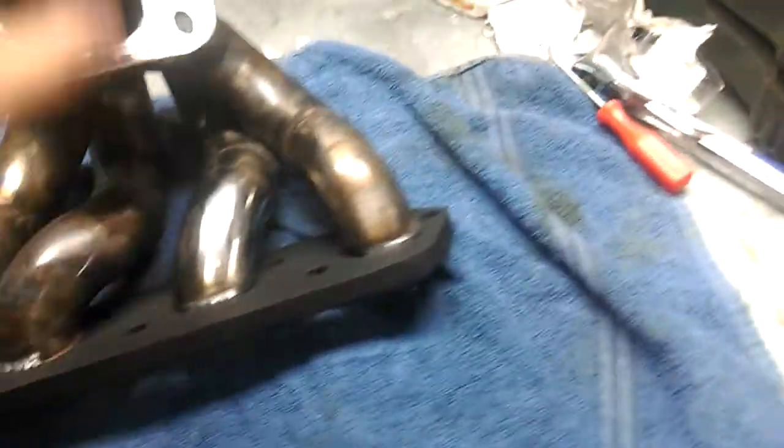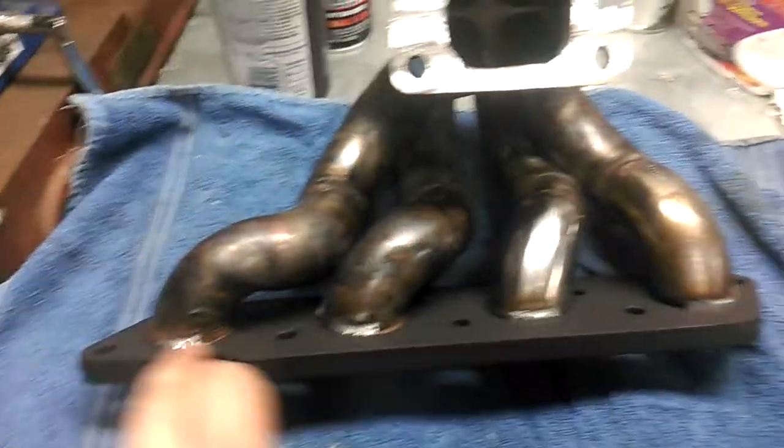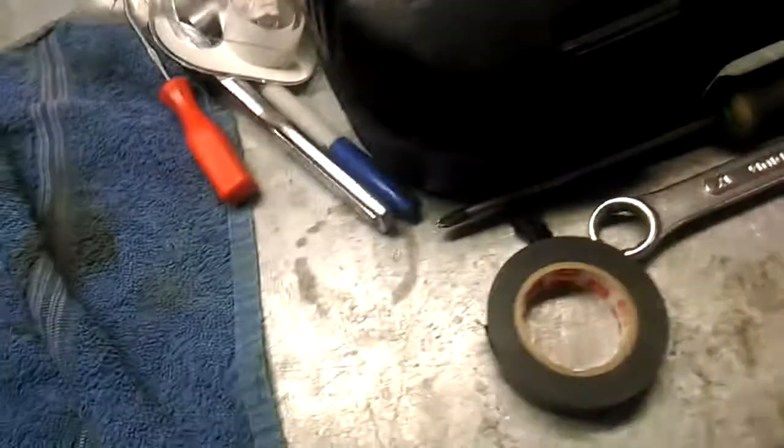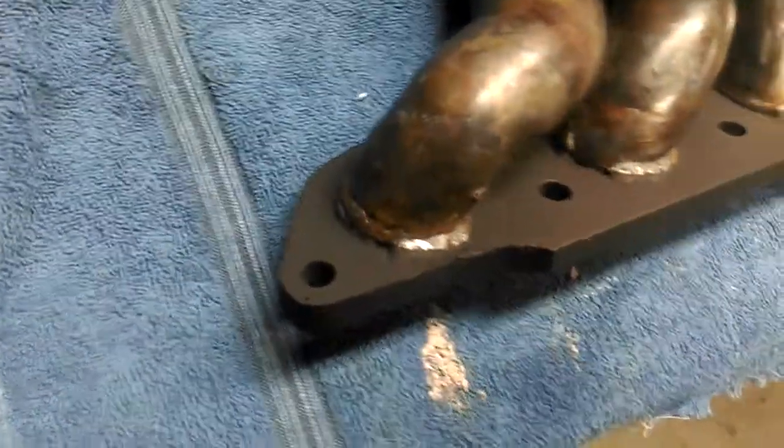What I did is I bought it, then cut the old Toyota flange off, and got a new one made to fit the Escort. That all lines up and fits with the Escort. Cut it out with the acetylene torch because it was just a square when I got it back from the machine shop. Cut all that out and made it clear everything it needed to.